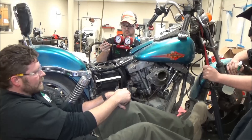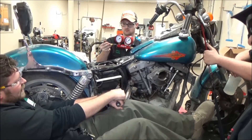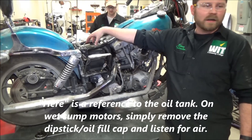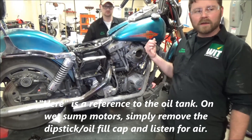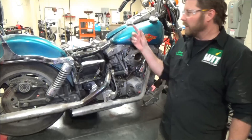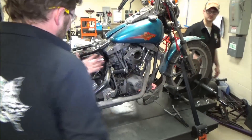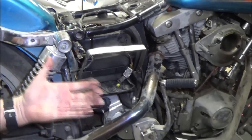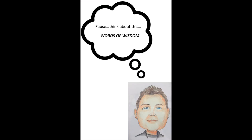I'm going to hold this with the kicker to accomplish this and speed it up. Any bubbling or air in the oil tank means the rings aren't doing their job. I couldn't see the gauge very well — look at my hand — I was holding on to that.